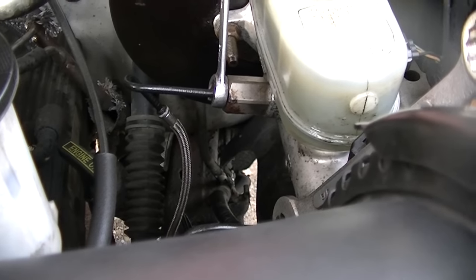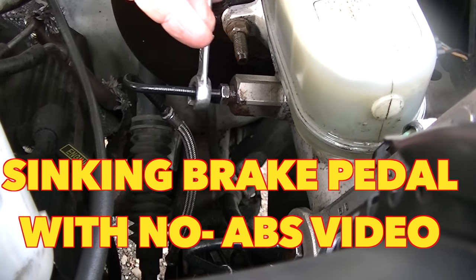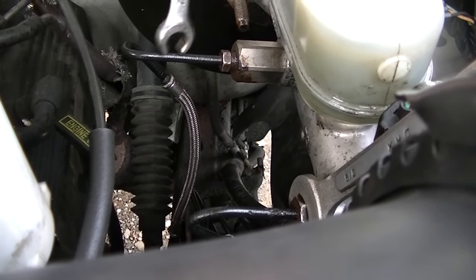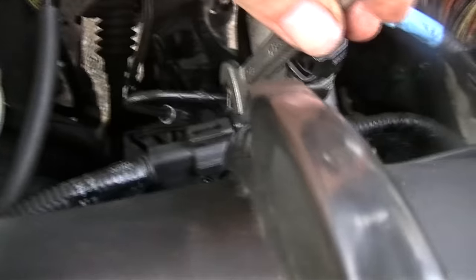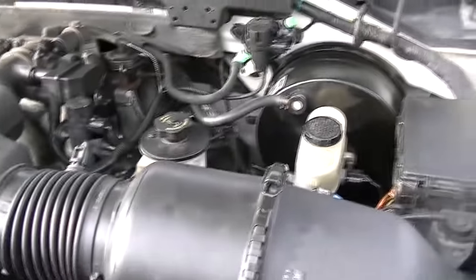You've got a couple of plugs, a couple of nuts to pop off, and two brake lines. Now if you didn't watch my other video on how to replace a sinking pedal master cylinder — sometimes these lines, when you break them loose, the whole line will turn with the nut. Watch that video to see how I got the nut to break free without breaking the line. You've got to have a set of brake line wrenches. I'd highly recommend buying some — they're cheap, you can get five or six different sizes for less than twenty dollars. One nut I had trouble with was a 5/8, so don't even try to use a regular wrench or you'll just round off the nut.